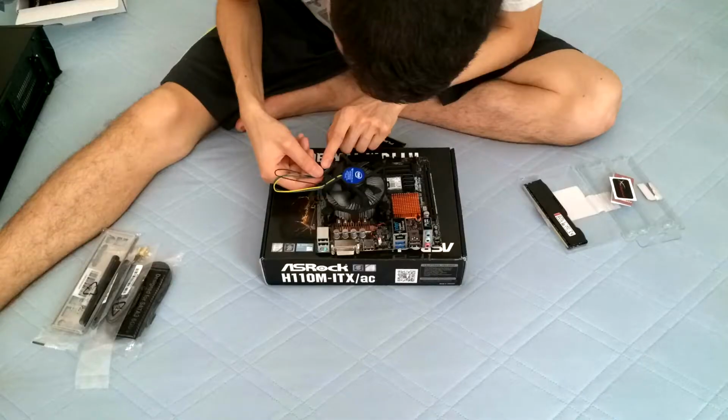I did run into some issues building this case. The stock cooler's cable management clip caused some clearance issue with the RAM, and it put some pressure on the closest RAM stick, and I was not comfortable with that, so I rotated the cooler just to avoid it.